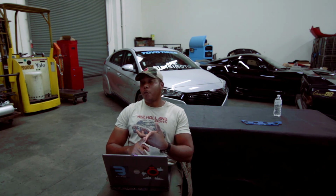Now, how much? It's very similar, it's just a derivation of M96 engine. Started its life as a 2.7, now hovers as a 3.2. That being said, sleeving, valve train, camshaft, so on and so forth, all involved, still hovers in the 40 to 50,000 range for the power plant itself. And then that doesn't get into the clutches and the transmission and so on and so forth. So for the engine, that's about right.